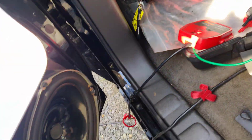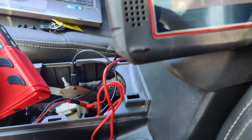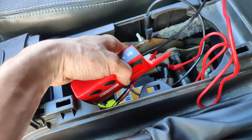If we flip these around, you don't see a signal there. Flip it at the door - when I move over to the other wire, the black wire, we got nothing. We got nothing all the way up here - no signal. So that wire's open.